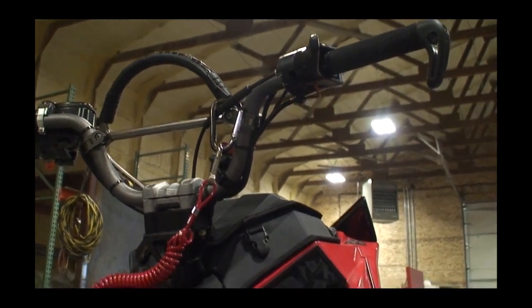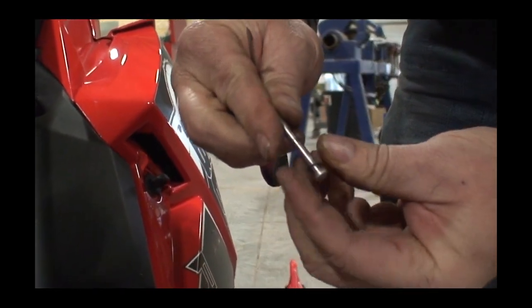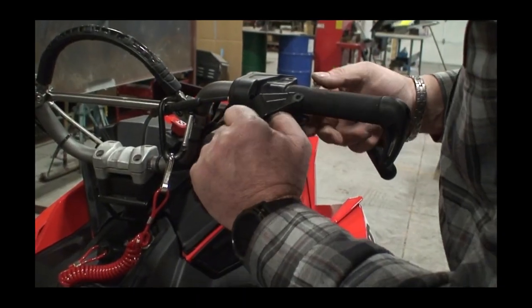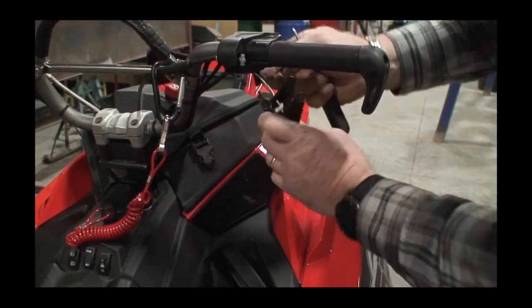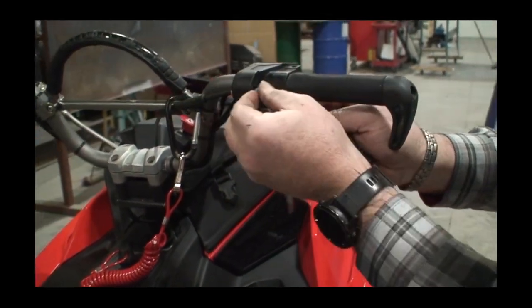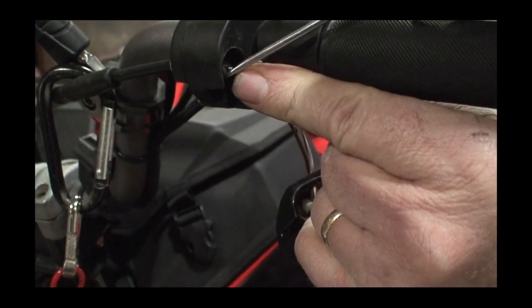Be careful, as this pin has multiple shims on the top, so just be careful. All the ones I've seen keep all the shims on the top. Now we are going to remove the throttle cable out of there — it also has a really tiny clip inside of it right in there.